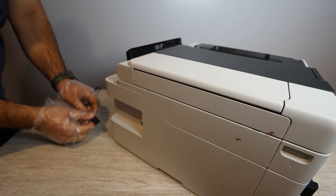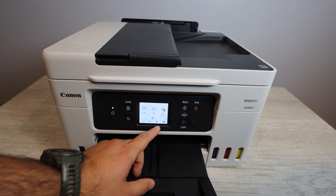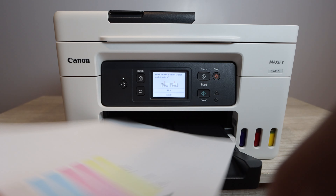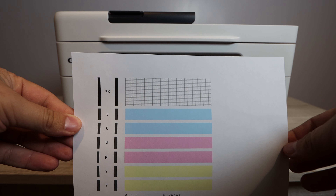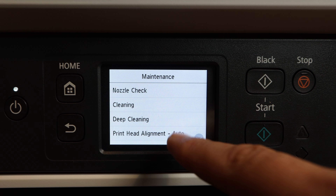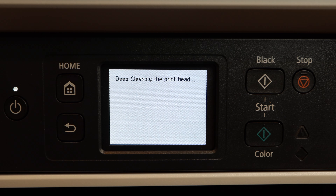The next step is to plug in the power cable and power on the printer. This is not where the repair ends — you're going to need to go into settings, then maintenance, and do a deep cleaning and a print head cleaning until you get the results you see on screen. This is what you want to see on your nozzle report: a healthy nozzle report means you're going to be able to print normally. Remember the product links down in the description: the best printers cleaning kit and the remanufactured ink. If you need additional support, visit bestprinters.tech.com. Thanks so much for watching, and until next time.